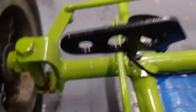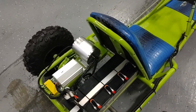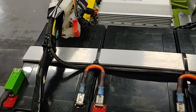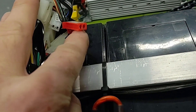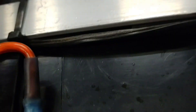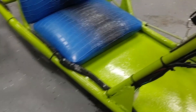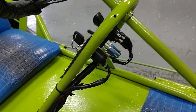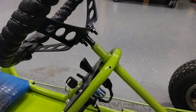One other thing I wanted to go over — as far as all these wires go, if you've got a kit like mine I'm going to try and help you out a little. They're all a little bit different as far as the labeling and the ends on the plugs go. I got a bunch of little pictures and symbols on all these wires and somebody's tried to translate them. One of them said 'charge,' which is good. But one of them said 'astern,' which made no sense to me — maybe it's got to do with turning a boat or something. Here's the thing: astern is your forward/reverse.